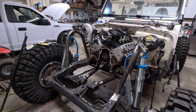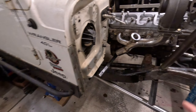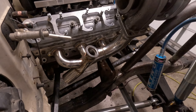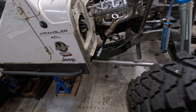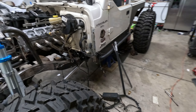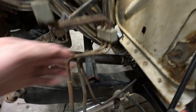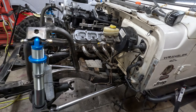On this build I know the pinion angle is quite a bit, so I may tilt mine down about five degrees - not sure yet. I gotta get the transmission on here before I can finalize the mounts because I don't want it hanging way down. I want everything to be right when I build these mounts because I'm also building a crossmember for the transmission. The only issue right now is the turbo is hitting my steering arm here, so I bought some turbo flanges and I'm gonna make a spacer to space it up. The hot side and everything else is going to clear fine.